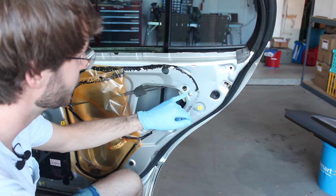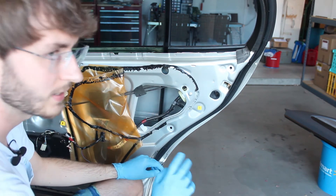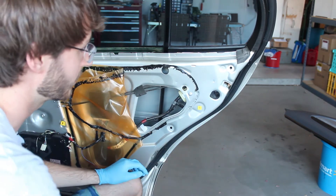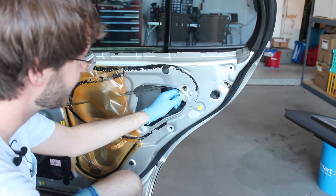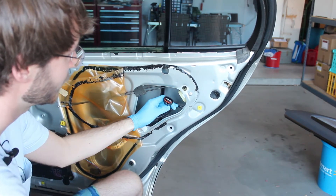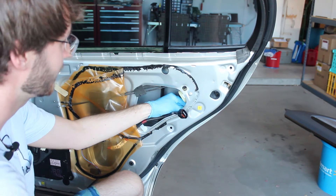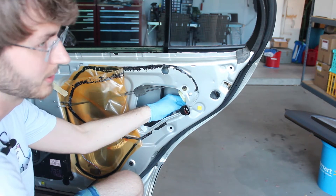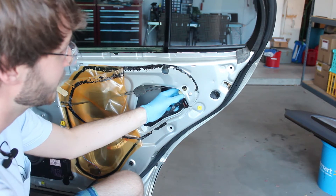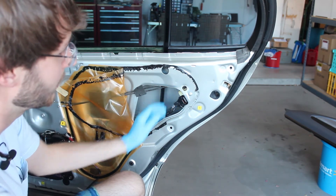In order to remove the actuator, you're going to need to take out a few bolts — there's one right here and three over here. They're all Torx T30 bolts. You're also going to need to disconnect these connectors right here; they're a bit hard to press, but you just have to press them pretty hard and pull them out. There's another one down here with tabs on the back. Once you do that, the door lock actuator should be loose and able to come out.